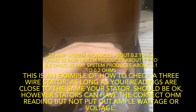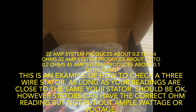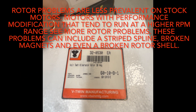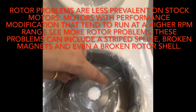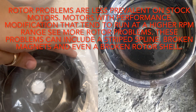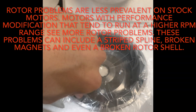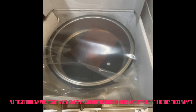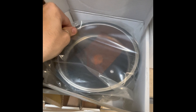This was just an example of how to check a three-wire stator. As long as your readings are close to the same, your stator should be okay. However, stators can have the correct ohm reading but not put out ample wattage or voltage. Rotor problems on modified engines are much more prevalent than stock. The spline can strip out, magnets commonly delaminate and start destroying other components, and the rotor shell can break or crack. Problems result in low stator voltage and the sound of rocks in your primary if it delaminates. You can upgrade to sealed units so you never have to worry about a magnet detaching.